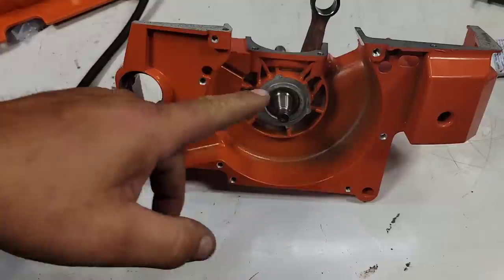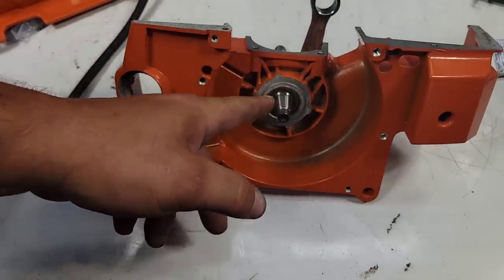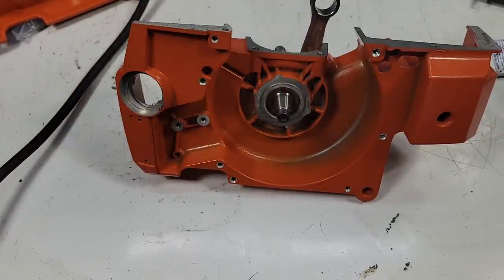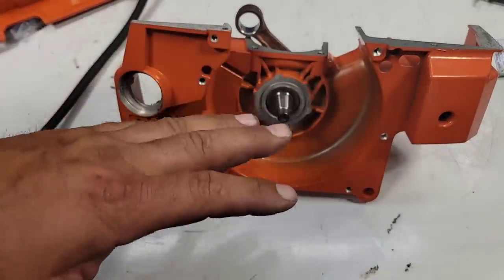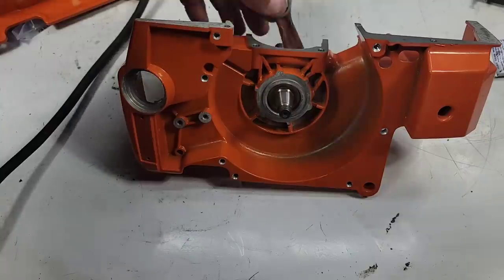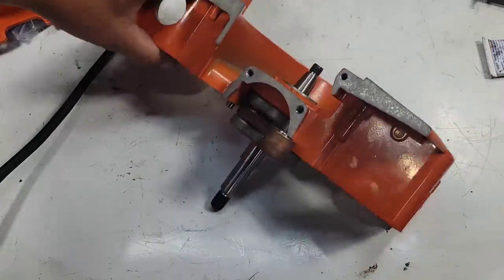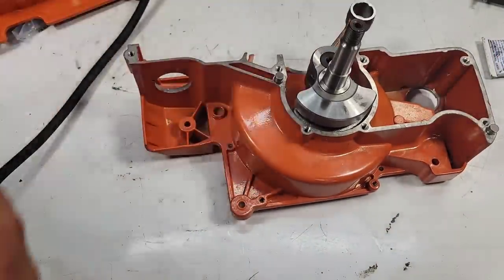So if I have side load on this bearing with the seal in, I can't feel it as well. You know what I mean? So, if you have the tool, pull this because you won't have the problem with side load that you do when you put it together with heat, okay? I'll show you guys all this. I'm just yakking as I put this thing together.